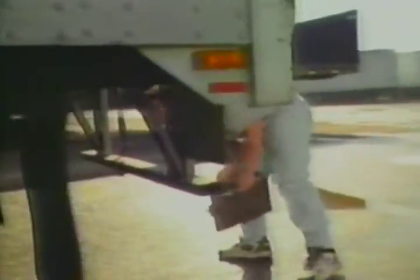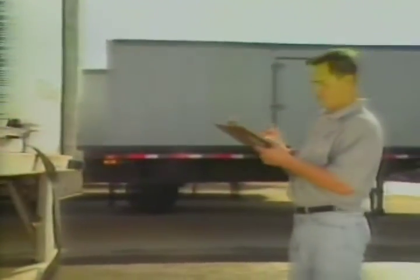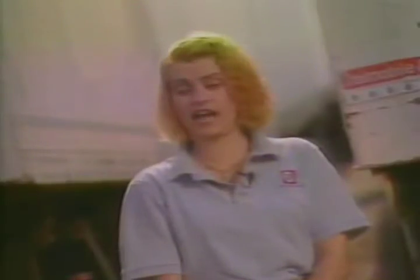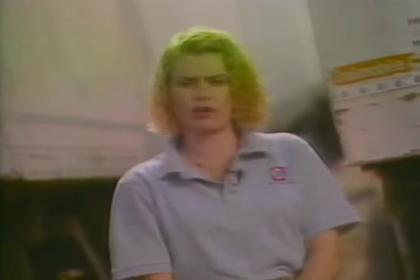As you get toward the rear of the trailer, you check the tires — making sure they're the right tread depth and air pressure, and that there's not a biased tire next to a radial tire. You look underneath and check the brake shoes, brake lines, and cross members. Then you move around to the back to check the door — does it go up and down properly, does it seal properly? You go inside and look at the roof and the ply. We do inspections both when a trailer leaves the yard and when it returns, to make sure the trailer is 100% road-ready and that previous damages are noted so the next customer won't be charged for them.